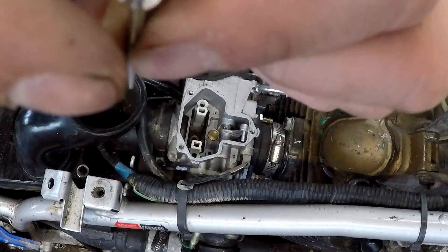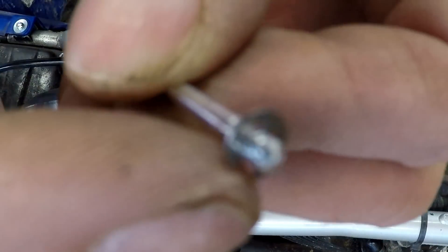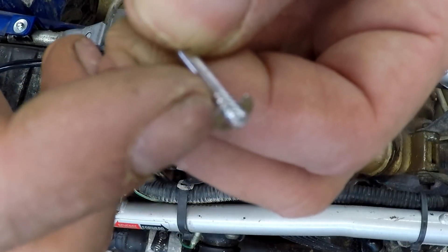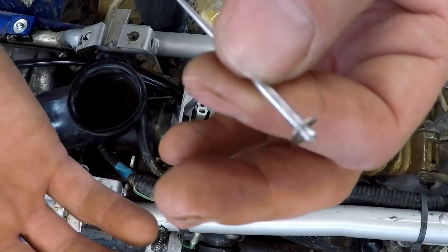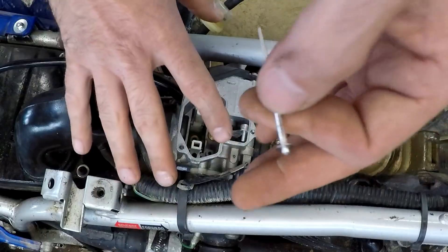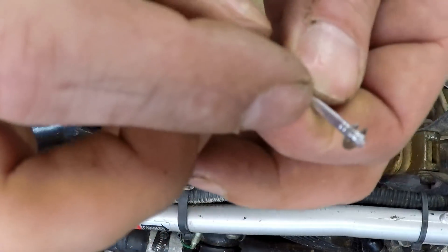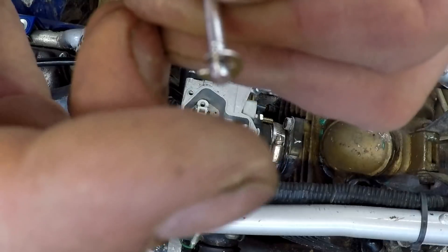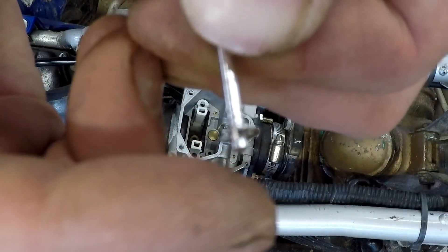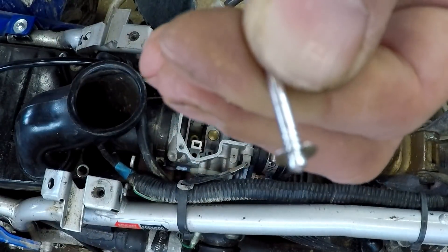Here's our jet needle. This little clip right here is what determines your air-fuel mixture — whether it's rich or lean. This came right from the store set a little lean. I think we're going to adjust it on the rich side here a little bit and just see how that affects how this is running — hopefully that's all it's going to take. Closer to one end is for a lean mixture, closer down the other way is for a rich mixture. I'm going to move it down to about the second notch from the highest on the rich side and see how it affects performance.